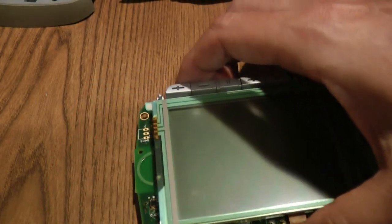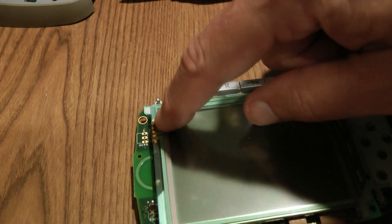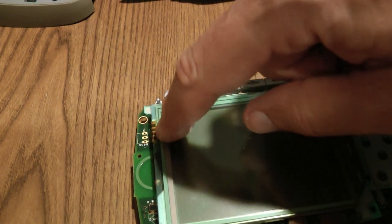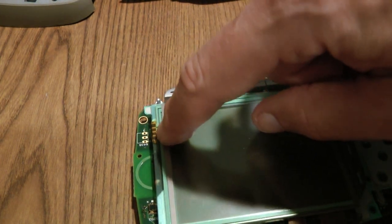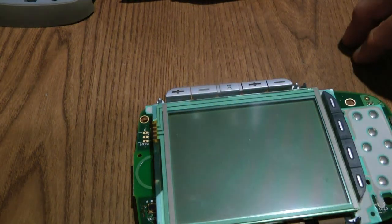Once you get this off, it's very easy. Just use a needle or a knife with a very sharp point and put four very small prick marks in the dark brown areas on that edge connector, and then your remote will start working again.